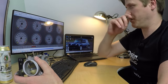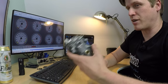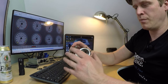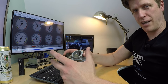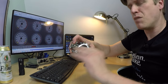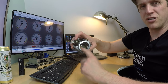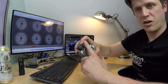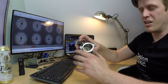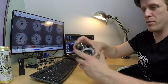That last 10–20 percent of throttle movement isn't really making a huge difference, but that first 10–20 percent — especially that first five percent — makes a huge difference, going from essentially zero to a fair amount. So at low revs, a small blip means the engine is probably getting most of the air it needs for just a few engine cycles — basically a full charge — but the ECU only sees 30 percent throttle. The key point is you're going to get a lot of change in engine state and airflow for small throttle openings.